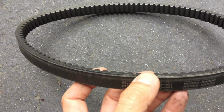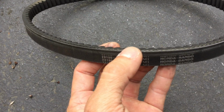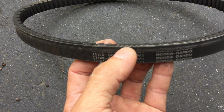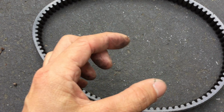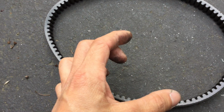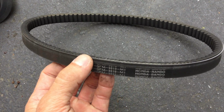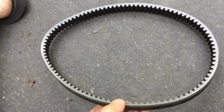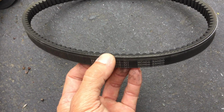I'm gonna figure something out, and once I do that, I'll test it and let you guys know. So it's not just about the variator spacer washer, but the thickness of the washer and also the length of the variator boss. Because the variator boss, I actually put it on the lathe and machined it down to the same thickness as that washer. So basically, I have to get another variator boss and machine it down less, to the thickness of the newer thinner washer. I think I have some washers, but I haven't played around with them yet. I haven't had the chance. Anyways, that's it.